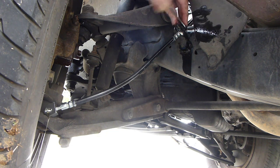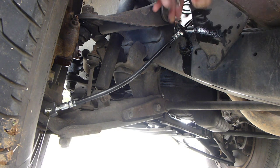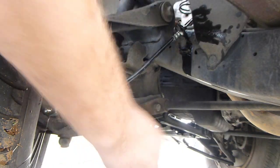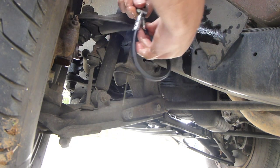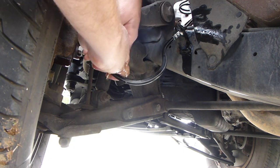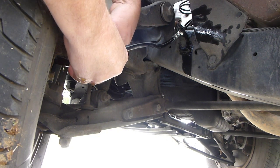Tighten it up — you don't want to tighten it too much, you just want to give it a good snug. I'll give it a little wiggle just in case there's a piece of grime in the thread messing with it, that way you'll know it's bumped over it. Take my bolt, put a washer on it — the washers come out of the kit of course — put it through the hose, put the other washer on it, and then install it. Got to make sure it's in that groove it's supposed to be in to keep it from turning — and it is.